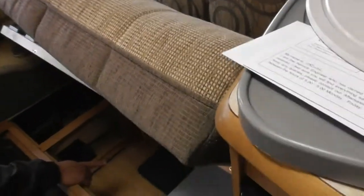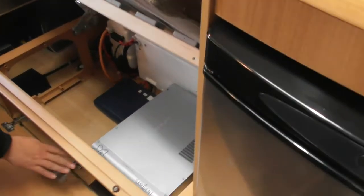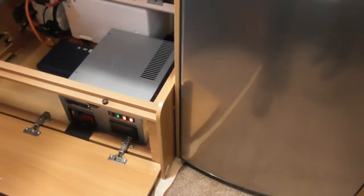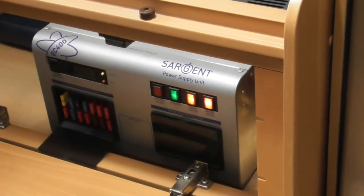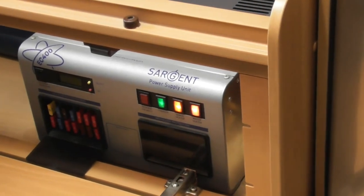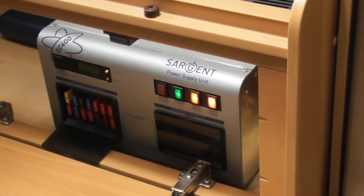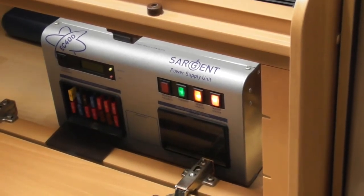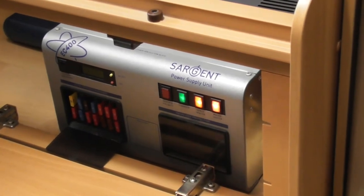The blue box here is the computer for your motor mover. And then here is what's called your consumer unit. So this is your sort of powerhouse for the caravan. This is where all its power source comes from. Now, on the end here is a system shutdown button. What that does is isolate all the power from the 12-volt system. So if you're leaving it in storage where you've got no electric, I would switch that off because it will stop any drain off your battery.